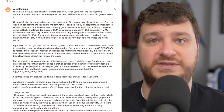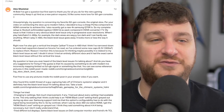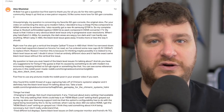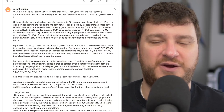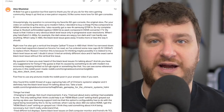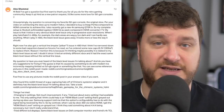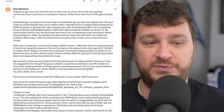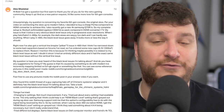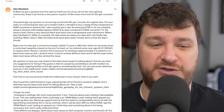That just comes down to personal preference. For me personally, if I'm playing on a CRT with composite or RF, whatever interference is on the screen doesn't really bother me. But that weird effect you get with those crappy cables for Super Nintendo and Genesis that treat 240p like 480i — that weird shaky interference really bothers me. So if the black level thing really bothers you, you've got to find a way to either switch your TV's mode, find a different converter, or figure out a different solution overall for the Xbox.